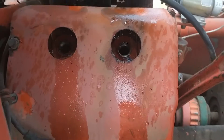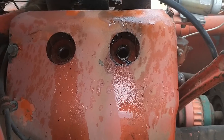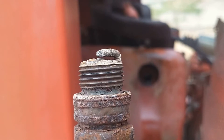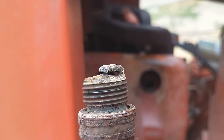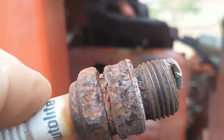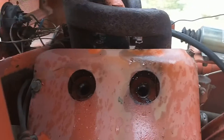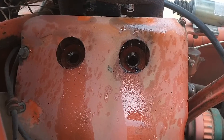This is a pretty old machine — I don't know that it'd be worth putting a new motor in it. Another interesting observation: I don't know if you can see it from the camera, but that spark plug has got carbon all the way through the point, so the thing was only running on three cylinders. That ought to be an easy fix — just put some new spark plugs in it if we get it running. No reason buying them now until we see if we can get this motor broke free.